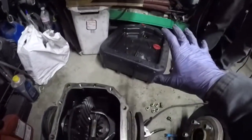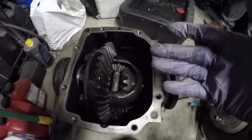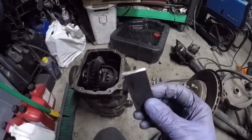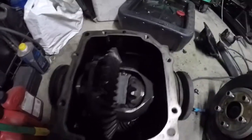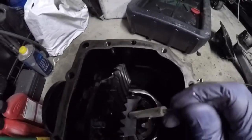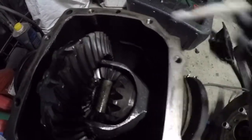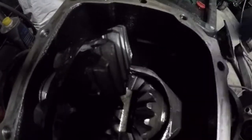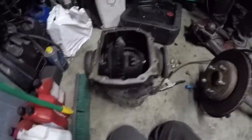Now we're going over to the diff. We drained the diff and cleaned all of it out very thoroughly with brake cleaner. What we're going to do is plate it — I have the plate right here, it's three-eighths of an inch. This guy is going to go right in here, like so. Once we get it aligned, that's where the plate gets welded in. But first, to make it a little stronger, we're going to weld in on both seams so that the gears are actually locked in place. Then we'll insert the plate and weld around the plate and go from there. E46 diff — welding it, then we're putting it back in.